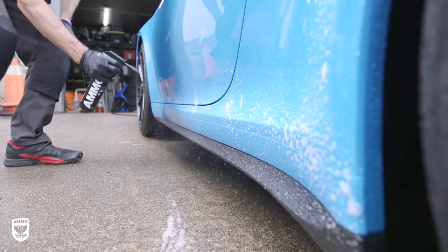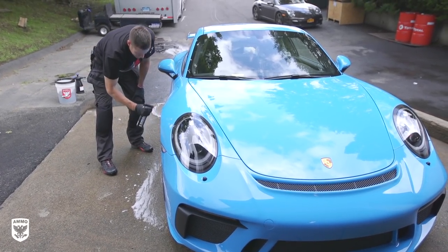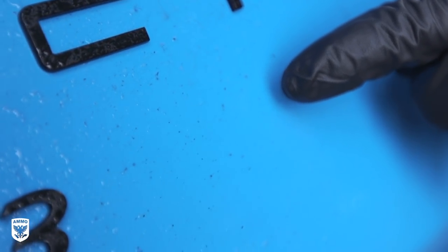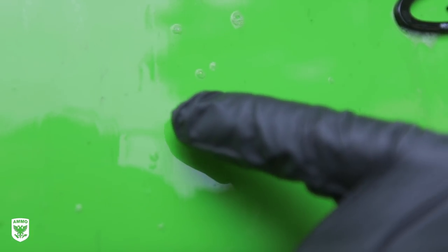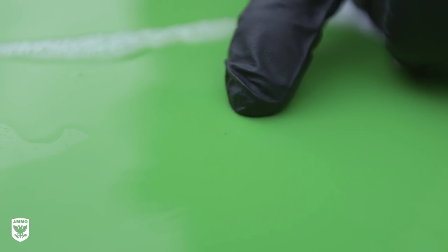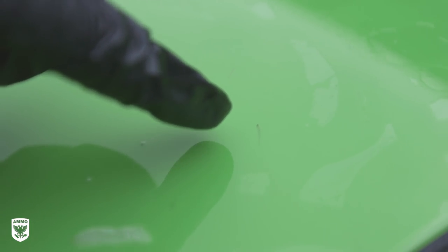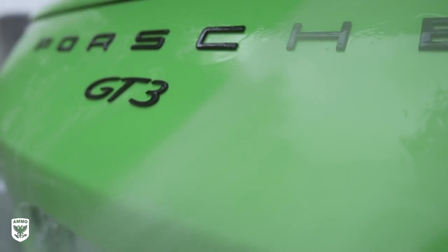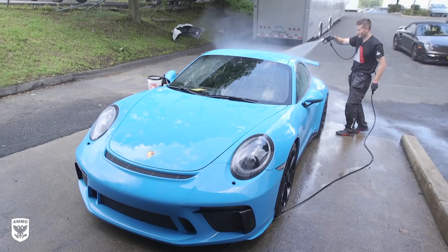Once done with all the wheels, I lightly misted plum again on the lower painted surfaces, the nose, and the trunk to release any brake, factory, or rail dust collected along its journey to the United States. You can use certain wheel cleaners that contain sodium thioglycolate — that color-changing characteristic we see on wheels — and you can also use it on paint as it will interact with the iron particles. I chose this instead of claying a brand new car, adhering to the idea of less aggressive technique first. After about two minutes, the light iron deposits were eaten away and removed with a power washer during the pre-rinse.